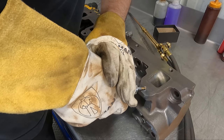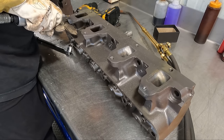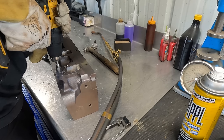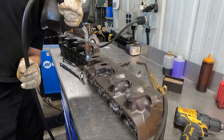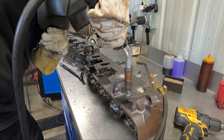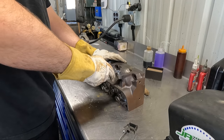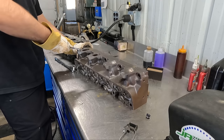Let's try to take what we learned and apply it to the next couple of bolts. Starting with the same process of drilling a hole in the center of the bolt — often the drilling step is really where people go wrong because they fail to drill on center and straight, and it can result in a broken drill bit acting as a pin in the bolt, so just don't do that. Take note of the sound of the weld here — my weld had a bit of a stutter. I decided I didn't have my wire speed high enough, which caused this. Both welds on both nuts were pretty much junk due to that stutter and they twisted off immediately.